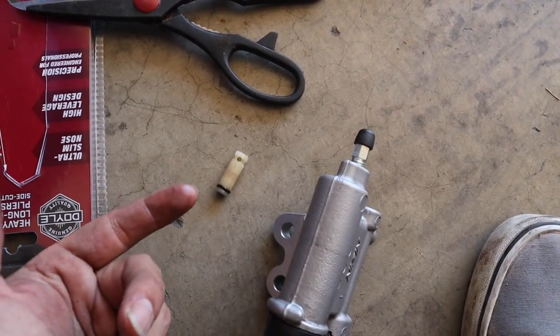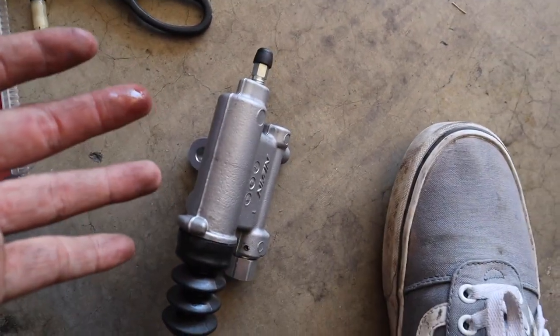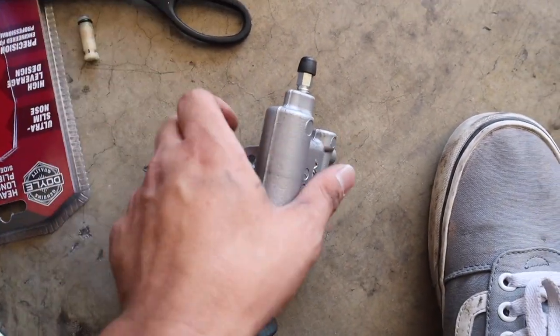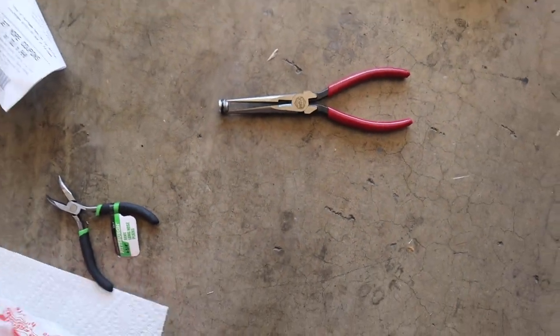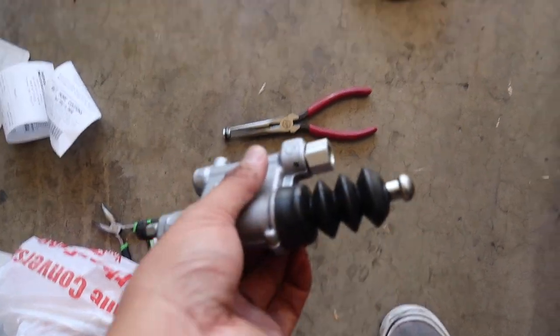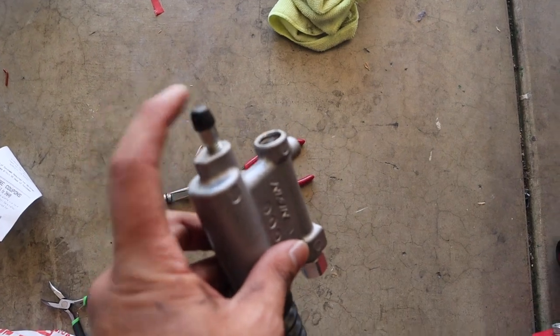Or if you want to keep it to put it back in later on, you're welcome to. I'm going to toss this thing out because you could always just buy a new clutch slave cylinder — I believe they're like $40 to $50 for a new one. Now all you got to do is put this piece back in. Obviously, you just reverse order and put the clip back on top. After that, go ahead and put this back in, install it, put the hard line back in, and we're going to bleed it through this little valve right here.